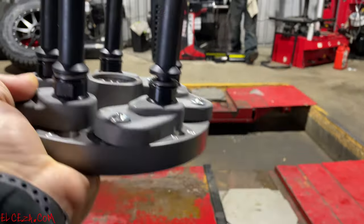Guys, if you move it a half inch off one way or the other, when you drop that hood and spin it, it's going to ask you for more weight. I promise you. This machine is that particular, which is kind of cool. Because now we're taking that $100,000 car and balancing the wheels, running RoadForce and straight track. We know which direction it's going to go. If we let go of the steering wheel, the alignment's straight. Straight track isn't right. We know which direction that car would pull, so we're going to put the tires on the other side to make it go straight, and I can do it with a half ounce or 1/4 ounce of weight or less. Therefore, my customer doesn't see, and I know y'all have all seen this.